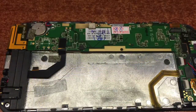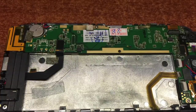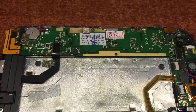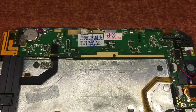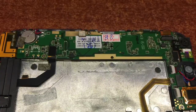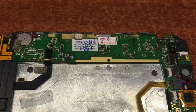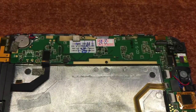This is the motherboard. Lift the screen really carefully — with your nails, go under it and lift it up, because the motherboard is fitted to the screen. You must lift it really, really carefully, otherwise you will crack the screen 100%. Go through the sides, and if you remove the back case — the aluminum case — then you will see this.